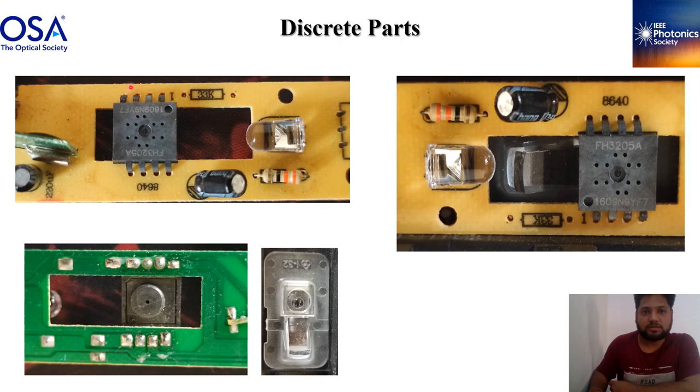As we saw, there is a CMOS chip which acts like a camera — it takes pictures of the surface. This is the light source, which is a red LED, and this is the arrangement of the lens. We can see from the bottom there is one hole for the CMOS and also one hole from this lens. Let's see the working of this whole arrangement in the next slide.